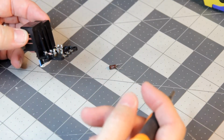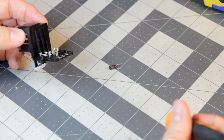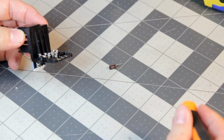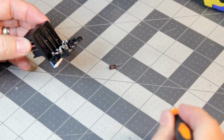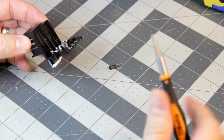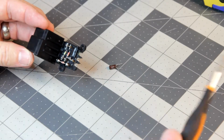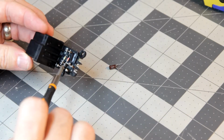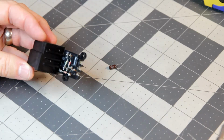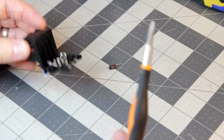There have been other electrical components in cars I've seen over the years. There's one that's become pretty famous, the Kelsey-Hayes ABS system, which was very common back in, I think, the 90s. It was ABS for GM cars, like you find in Corvettes, and like my Honda Passport, which is another car I have. It has a Kelsey-Hayes ABS, and they're well known to start throwing a code, C1204 or something like that. That's probably not the correct code, but they will start throwing that code, and the reality is there's a solder joint that's slightly broken on the relay. What you do to fix it, instead of spending potentially up to $1,000 for a new ABS unit, is take it out, crack it open, carefully resolder all the joints, put it back together, and that usually fixes the problem.